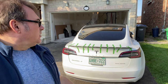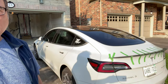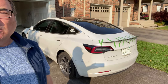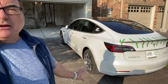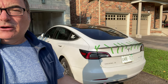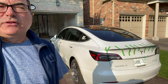Hopefully this will hold. I just put a whole whack of painter's tape on here to let it sit. It's a nice day — a little cool, but the sun's out — and it's supposed to get up to about 19 or 20 degrees Celsius today, so I'm going to leave it outside in the sun all day. Let it get nice and warm so it will relax the adhesive and be able to bond properly. I'm going to leave it for 24 hours, as they recommend — or at least don't get it wet for 24 hours. It's not supposed to rain till tomorrow, so that's why I'm doing it today. Hopefully it looks good, and I'll show you what it looks like when I have all the tape off.